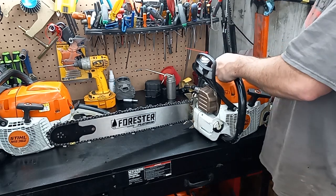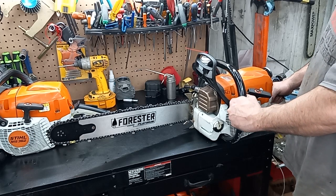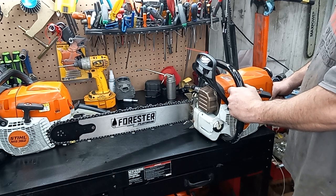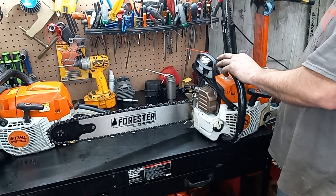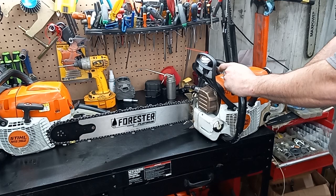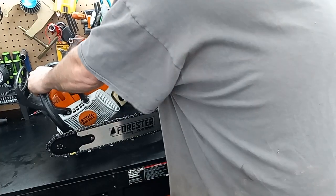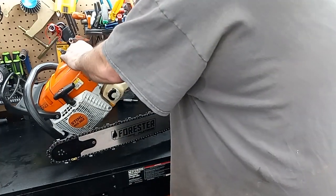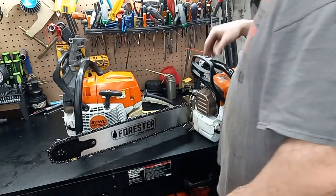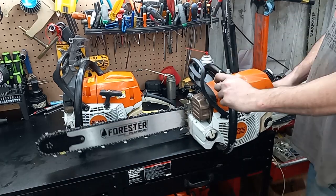This other one's on a 100 roof with massive pop-up in it. I think that pop-up was like 75 thousandths when I measured it. So it'll be neat to see how that one feels compared to that one. That one should be more grunty. This one should be more RPM-y, with enough grunt to still be able to do what you got to do. But this one, the mounts are still all stock, and these ones weren't quite as flibbly flobbly as what these ones were. But that feels really good now.